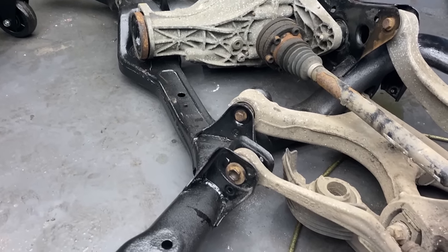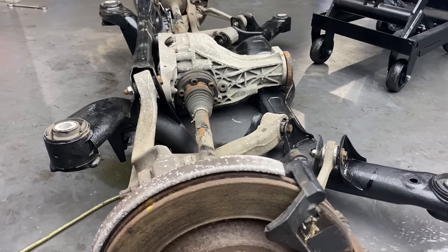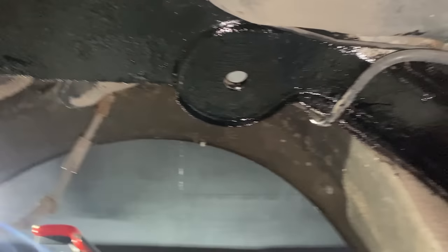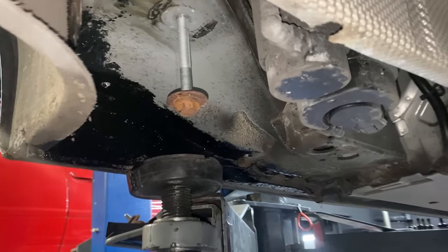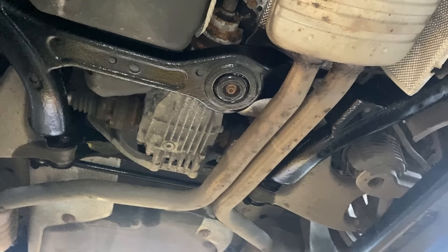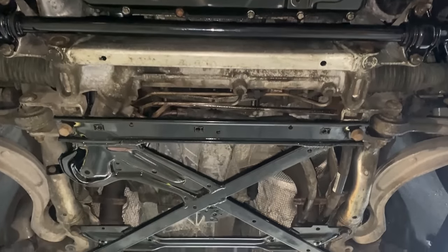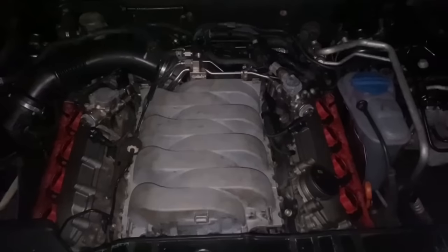Basically, before I'm putting the refurb subframe back onto the car, I did sort out the chassis the best way possible. I took most of the rust off with the wire brush drill, and I put some metal build paint on it, and then we just put some adhesive on it so it's protected from the rust. So that should sort out the issue meanwhile. It's not the best job, guys, but unfortunately we always have some limit with the budget. Most of the budget went onto the engine because you've seen the stage of it, and we sorted out the rest as we could.